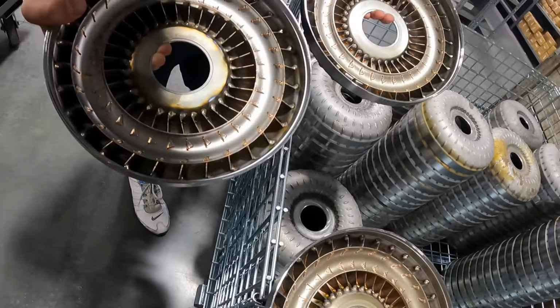We consider the drive plate. So that's constantly spinning. Okay. And this is going to be welded to your impeller. So this is constantly spinning, moving fluid. So that moves with the engine. With the engine. Right, yeah. Because it's welded together. Correct, or bolted together. Right.